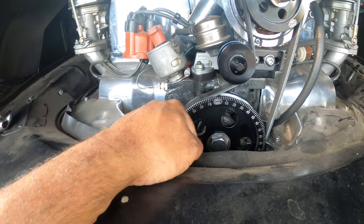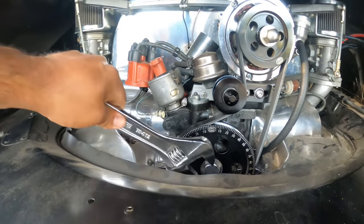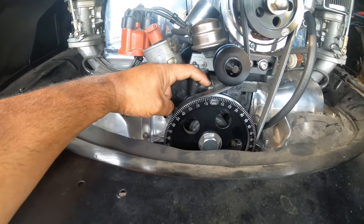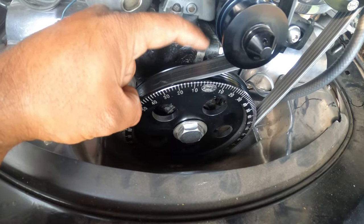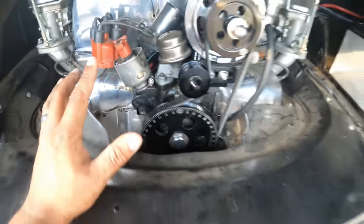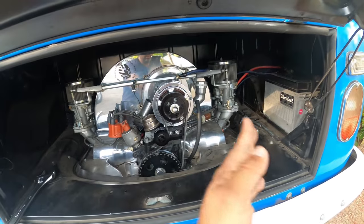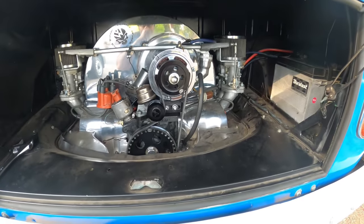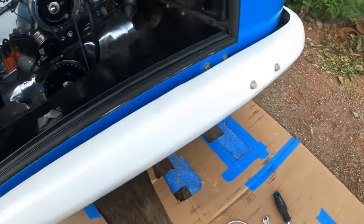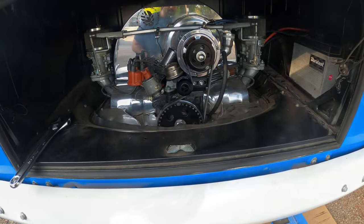On this motor, this pulley — I don't have a TDC mark, I have a BDC, but the MP logo on this pulley is our TDC mark. TDC stands for top dead center. We want to make sure we're right on point. The notch back here on the back of the engine is our marker which tells us where we're supposed to be — from here to here, this is TDC. So we are set on point. Next, go down below and go to your valve cover. You want to take one valve cover at a time off, because they drip a little bit of oil, so you don't want to make a huge mess. Get a rag, make sure it's covered so it catches the oil that drips.